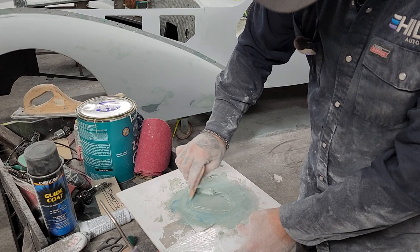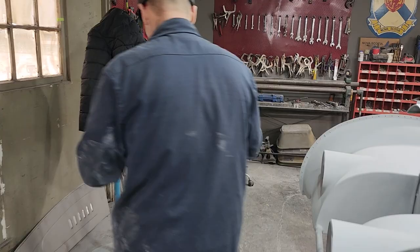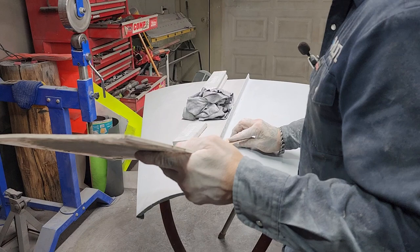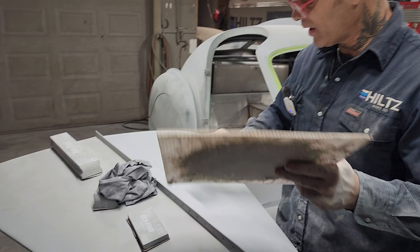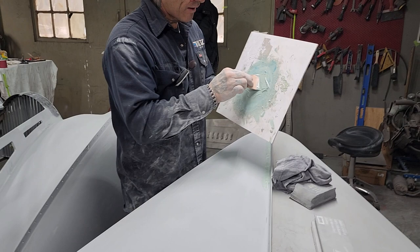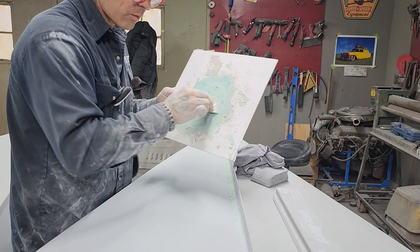Myself a little squeegee. Make a small one. I'm not going to have to use all that, but I'm not going to do just the places that have low spots in. Not going to do that. And the reason being is I find that if you're putting just filler in one spot and you have something beside it, it just means you have to go back and fix another spot. So generally what I like to do where it's in that seam, we'll do the whole thing.